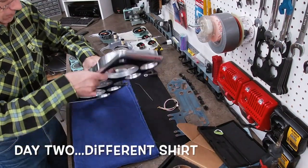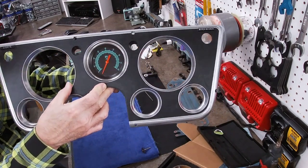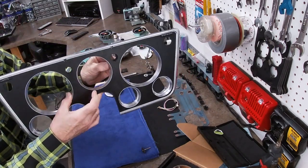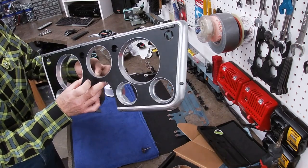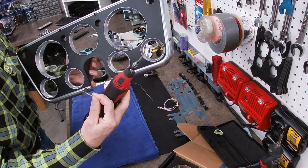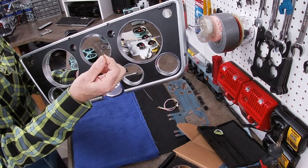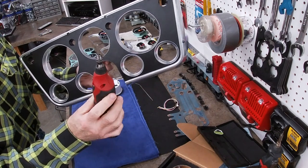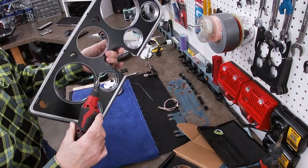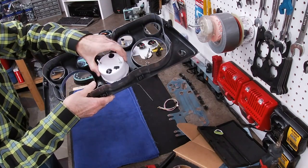Well, I've made some progress. I think it's pretty darn good progress. You can see that there. I've got that fitting in very well. And the way that I did it was that once I used a caliper to scribe the depth that I needed to cut at, I used a cutoff wheel on my Dremel, or actually my Milwaukee rotary tool, and I cut along close to the line that I had scribed with the small cutoff tool, and then cleaned it up using a carbide tip to get it right down to the line, so that I've got a nice surface. It's fairly even, and then the gauge just sits